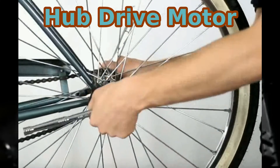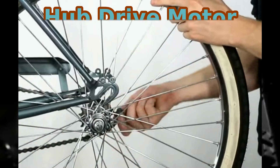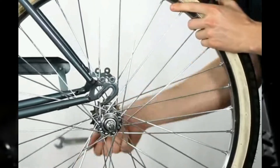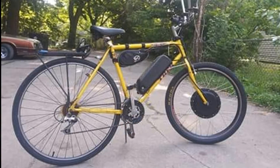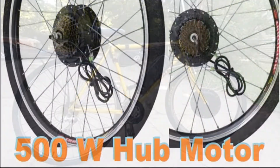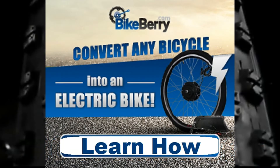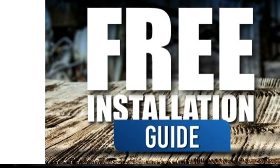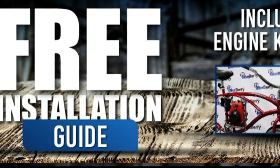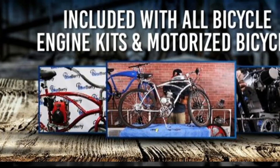The wheel goes on next. When installing a hub motor wheel, first you want to know your new e-bike wheel will fit to the width of the opening in your frame. Don't worry if the wheel diameter is different from the new 26-inch mod wheel — frames in this wheel size range should be compatible enough to use. There are just two basic standard widths for hub drive wheels: a larger clearance for mountain bikes at 135 millimeters, and the standard for road bikes like 10-speeds at 130 millimeters.